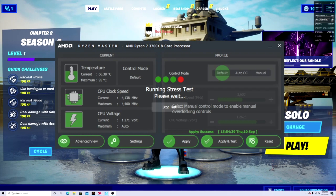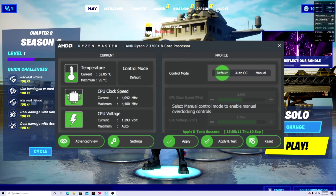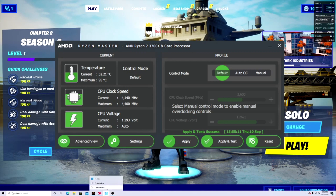If I'm going to be streaming and playing video games at the same time, I need to keep that 3700X cool. For me, somewhere around 65 degrees is a good range. When I took the stress test off, you can see it drops back down to the 50s. And when I turned the game off altogether and went back to idle, the numbers drop back down to around 40 degrees.